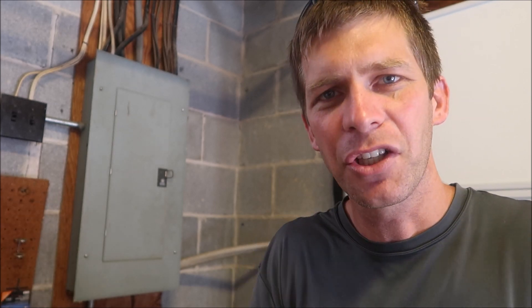If you feel like you need to do it more than that, great. For a homeowner just mowing their own personal yard with a small yard, honestly you could probably get away with sharpening once a year, or just take it off and put a new set on. You can check the blades to see how sharp they are by looking at that last section. I would try to sharpen mine maybe three or four times and then get a new set. If I had one mower I might buy three or four sets of blades at the beginning of the year — take one set off, put another set on while I'm there, and sharpen the old set later. Have at least two sets so you can keep them rotated.